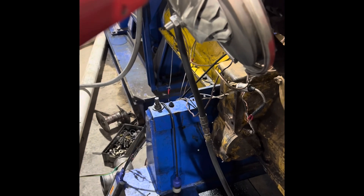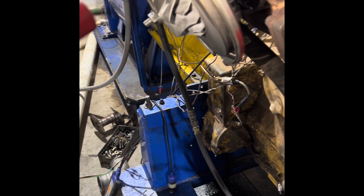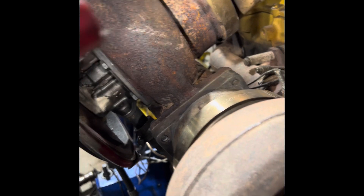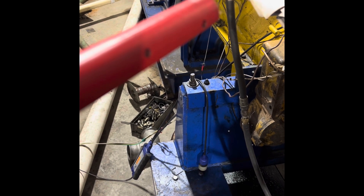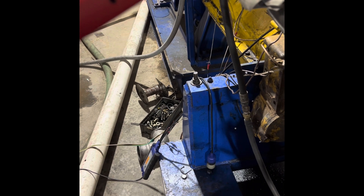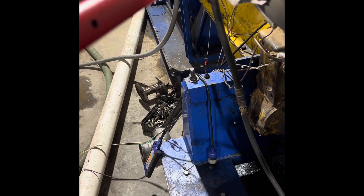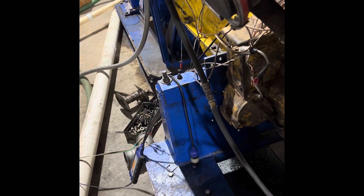We were running as much as 63 pounds of back pressure and 65-66 pounds of boost total. The low-pressure turbo is just an old HC 5a. This is a 3.6-inch or 91.5-millimeter compressor wheel. It is meant to be a low-pressure turbo so it's kind of well-suited. This is a 41-centimeter turbine - I've switched back and forth between 41 and 48, but that's the 41.